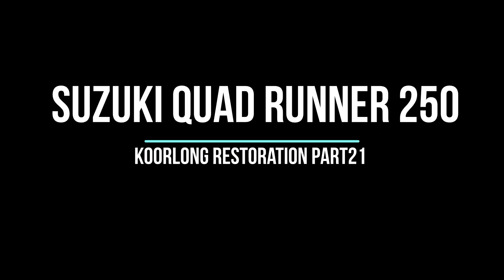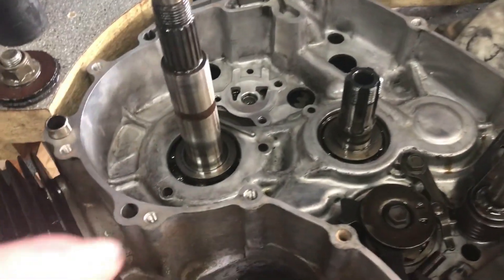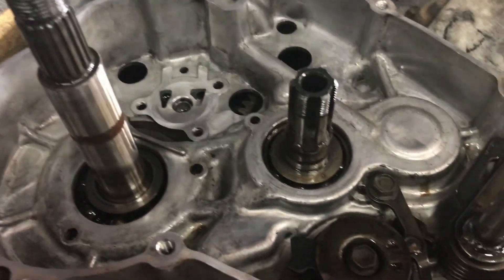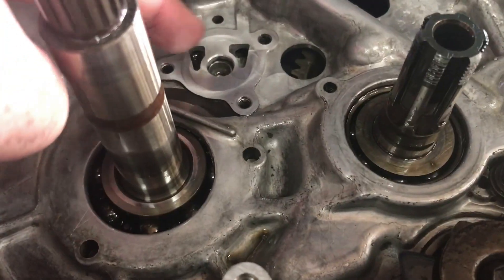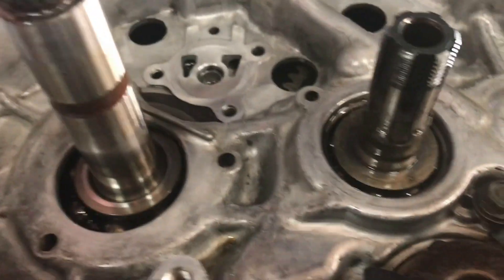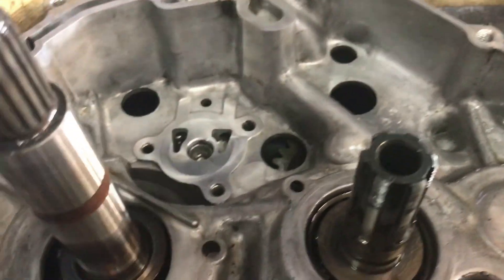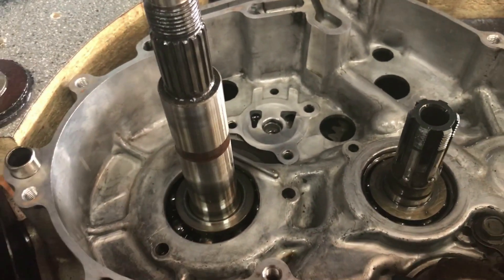Today I'm just going to ramble on about the clutches, the oil pump, and the cover - get it cleaned up with a new gasket. I've lifted a few things out of this case, obviously the clutches. I've released the oil pump - that's the little pinion that goes on the crankshaft - and I've been mopping out the floor of this case with the paper shop rag. It's all looking pretty good.